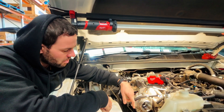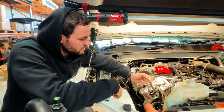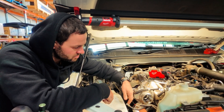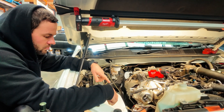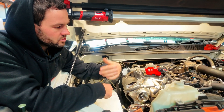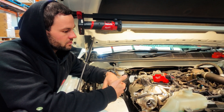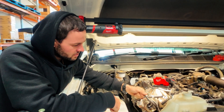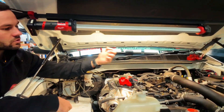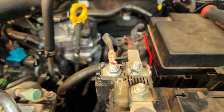Before disconnecting the positive terminal, it's a good idea to disconnect the negative first so you don't have to worry about anything touching ground or shorting out. Now, we'll heat shrink the old cable since we no longer use it, and cable tie it back up. We don't strip it out of the harness since it branches everywhere — just heat shrink the end at the alternator side and also the end at the battery positive terminal on the D-Max, which is the one closest to the engine.